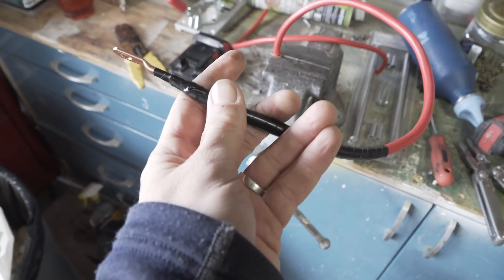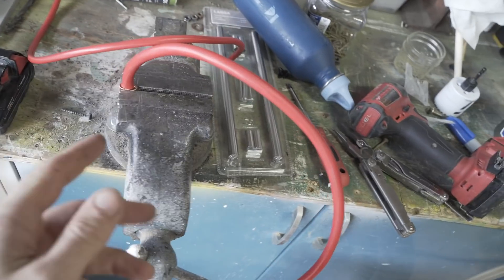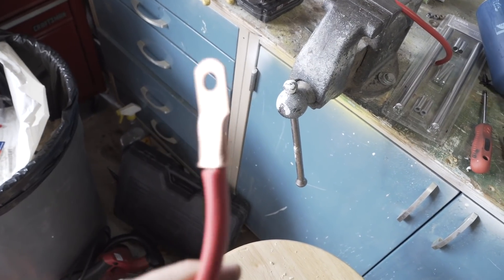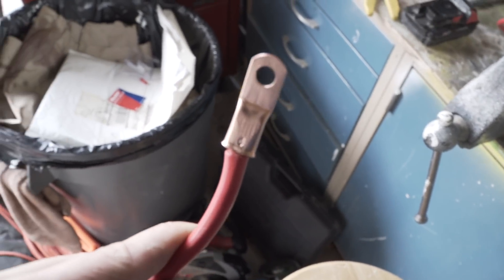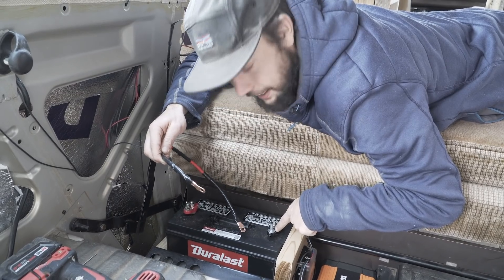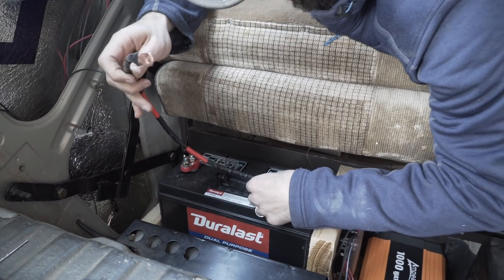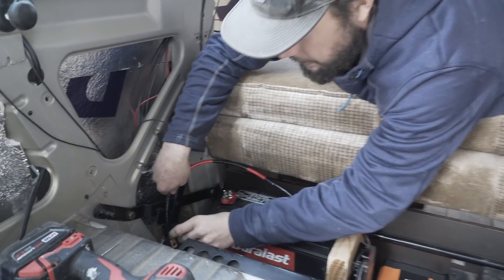My ground connection for my battery — I just cut and crimped it. I use a lot of electrical tape because it's supposed to be a black cord but I'm saving money. I crimp my terminals with the vice — give it a good crank. I taped it black and I'm going to connect it to the marine terminal. I drilled a hole and put a bolt through the body of the van, then attach each end so the battery is grounded.